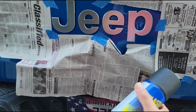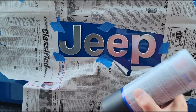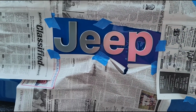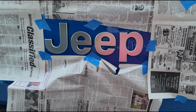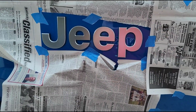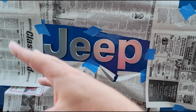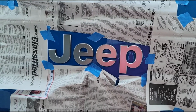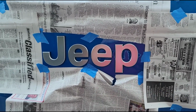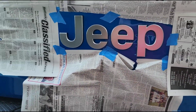But anyway, got it all taped off, and all you have to do is follow the instructions on the can. Now I'm gonna shake this really well because the can on the back, if you read the instructions, it makes it very obvious that you got to shake this really well to mix all the chemical up in there. And then what I'm going to do is just go over it with a light tack coat, give it just a little bit of time to dry, hit it again, a little bit of time to dry, and then the third time around I'll give a good coverage of the product, but it goes on pretty well. And then after you give it 3 or 4 hours to cure, then you can take all your newspaper and stuff off of there, and you should be ready to start peeling away from the outsides of the letters and the insides and so forth. So let me go ahead and get this shaken up real good and spray this first coat, and then I'll show you what it looks like.